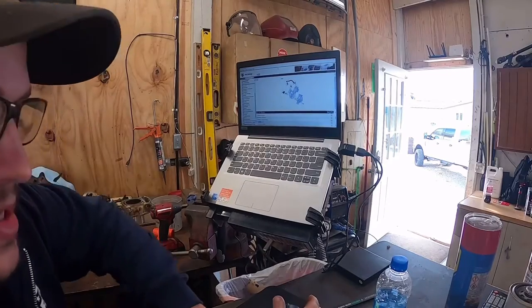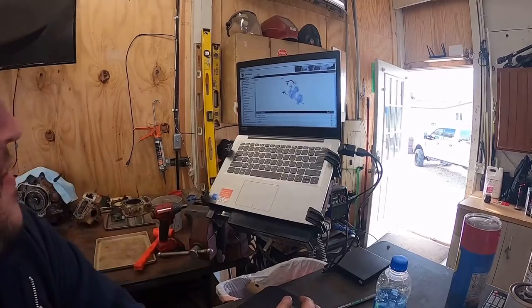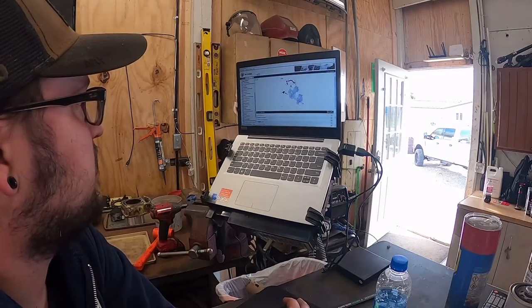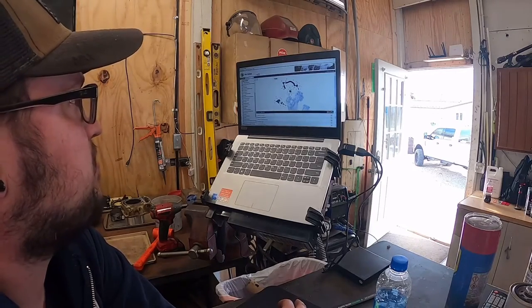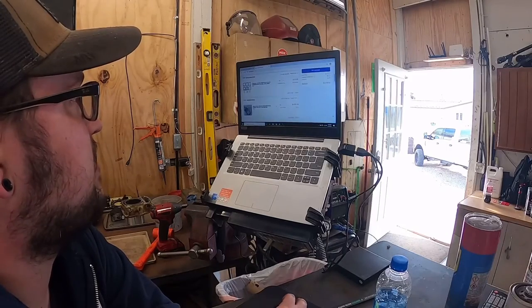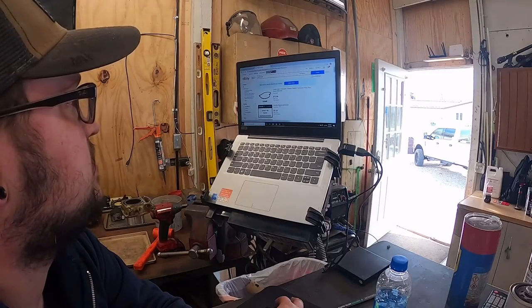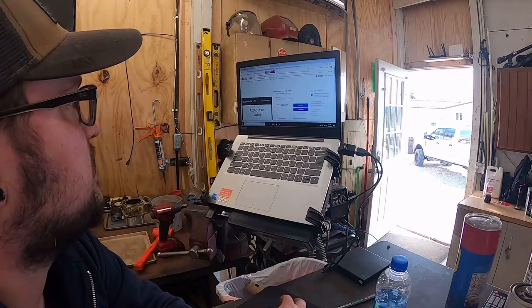All right, so what I'm doing here is getting all the parts together. I bought a CD off Amazon that's a service manual, not an owner's manual, and a parts catalog for this. So I'm just going in here to the schematics, pulling it up. So I pulled the water pump off. So I need number 12. I just need the gasket. So just minus that out, come up here to eBay, copy the part number, right there it is, it's a 42065-1191 OEM, add that to the cart.